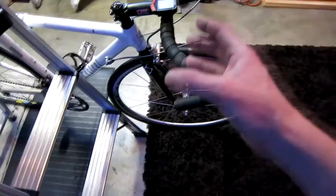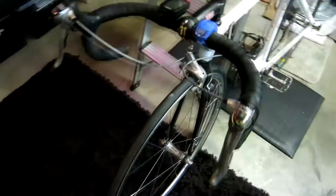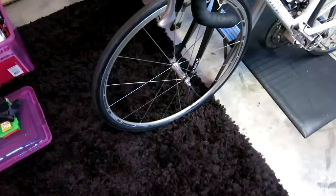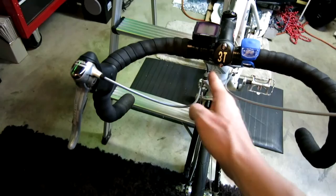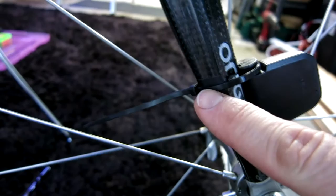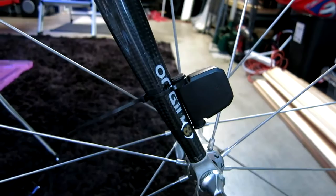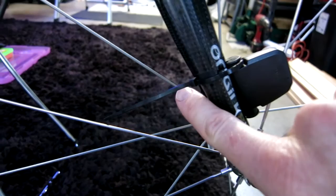For the wired guys, it makes it a lot simpler to go up with the brake cable, so you can wrap the wired one all the way up, vice versa. For the wireless ones, you can do either side — it doesn't matter at all. Wired, you probably want to go up the side with the brake lever cables so you can wrap it around a little bit more cleanly to be a little bit more stealth. The zip tie goes around these little notches of the sensor, and it's going to be pretty much the same thing on a wired one as well. I have electrical tape underneath the zip tie and underneath the sensor. We're going to make sure everything looks good and clean, then snip the ends and put the bottom zip tie on.